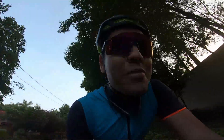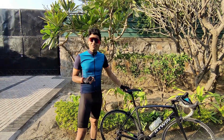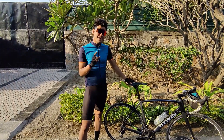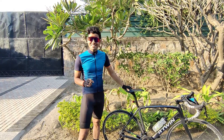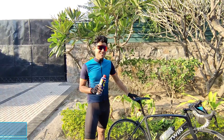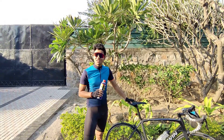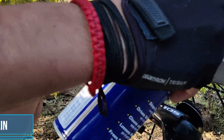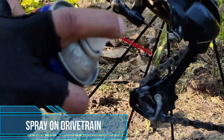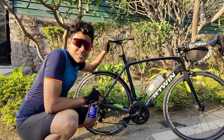This whole country is our beautiful country and we will explore it. Whenever you are on the go on your cycle, it's really important to take care of your drivetrain. When we recently went to Jaisalmer, it was really hard to maintain it. For that you need something really special, and that is WD-40, which you can use to clean all of your drivetrain very quickly and efficiently. The very first step is to spray it on your drivetrain — put it on your chain, your cassette, and your jockey wheel.